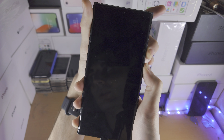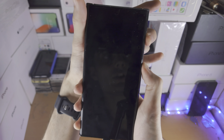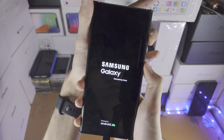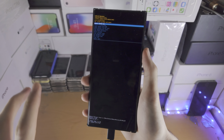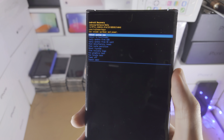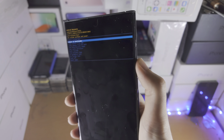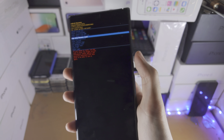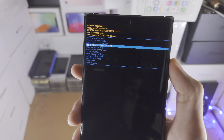Let's do this together — starting in three, two, one. Press power and volume down and hold for 15 seconds, counting up to fifteen. Now release power and volume down, then press and hold power and volume up, keeping both held down until you see the recovery screen. If you fail, just rewind the video and press the buttons exactly as shown.